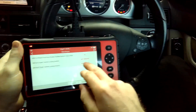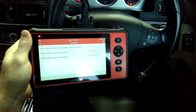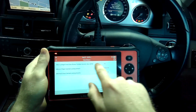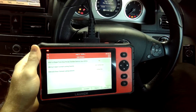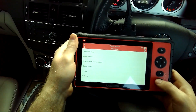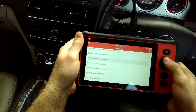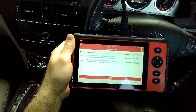The customer confirmed that the passenger door lock had actually failed quite a while ago but they weren't worried about that — it was when the driver's door became a problem that they wanted it looked at. With the information from the scan tool, I could verify there were no wiring breaks going to the module, the switches were active, and the lock actuator wasn't responding even though the command was being sent. The 100% diagnosis will be when the panel is off, but given that information I was able to give a quote for the repairs. The customer was very happy to get that information during a service visit.